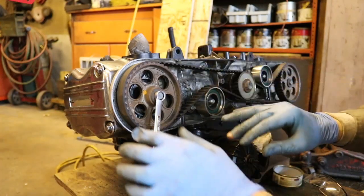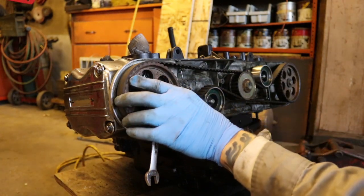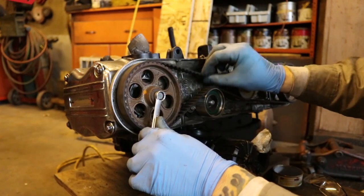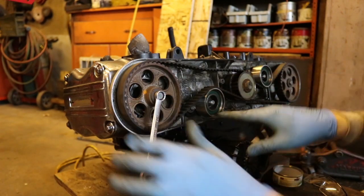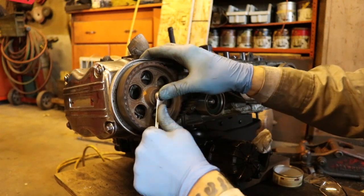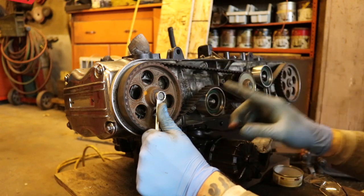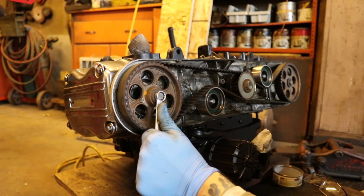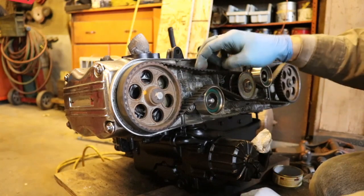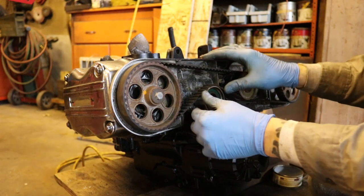All right, the almost final step is this: because this side, on the right side of the engine, this right camshaft pulley, it wants to torque that way, and it results in this guy being loose. So before you tighten down these bolts here, you want to put a wrench on here, put tension so that this is nice and tight there, then simultaneously tighten down these guys. Good tension, perfect, perfect, perfect. Everything is aligned the way it's supposed to be.